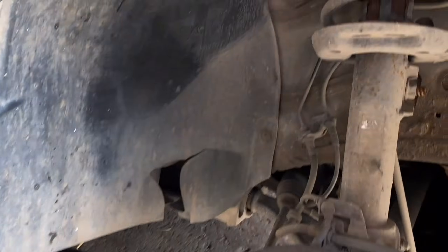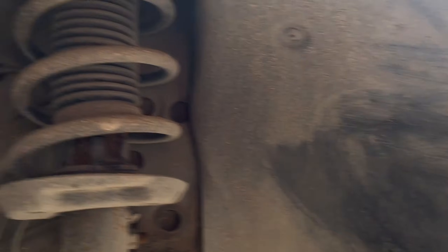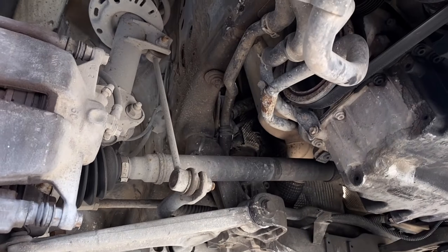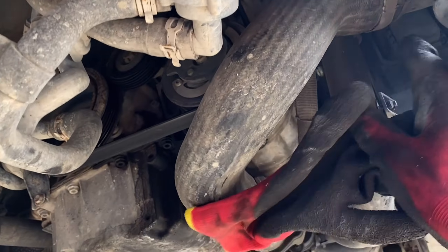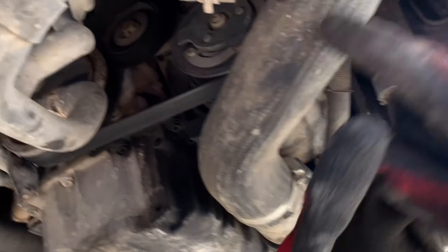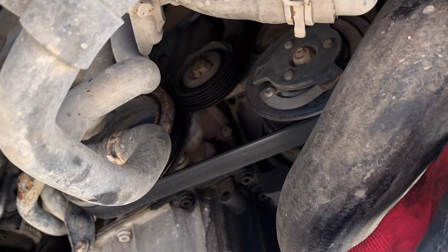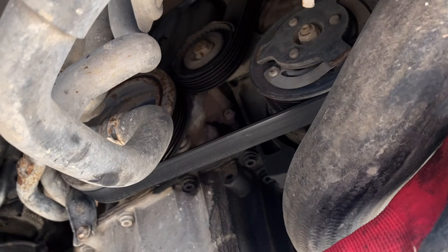The inner wheel arch liner uses T25s — there are plenty of them. I doubt yours will have a Phillips screw in it but you never know. Let's get the inner wheel arch liner and under tray out. Now I'm going to get this boost pipe out of the way — we've got a jubilee clip — and then I'm going to use a 16mm swan neck spanner to take the auxiliary belt off the pulley in the middle. A swan neck is good but a normal 16mm spanner can work too.